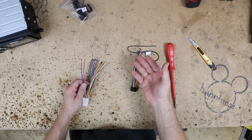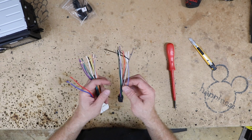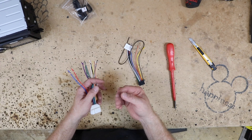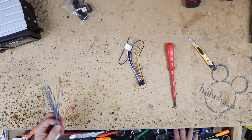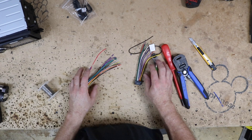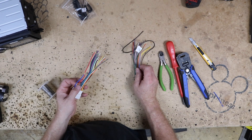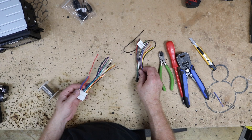If you have an actual power antenna that moves up and down, go ahead and connect it to the blue-white wire. But a better option is to put an actual toggle switch in so you can turn it off, because nowadays most people don't even listen to the radio. The red wire is the accessory — it turns on and off with the key, which is all we need that antenna booster to do. The reason we don't like hooking it to the blue-white wire is that in some cars — Toyotas, Nissans — this wire can draw more amperage than the blue-white will supply. The red wire has more amperage output.